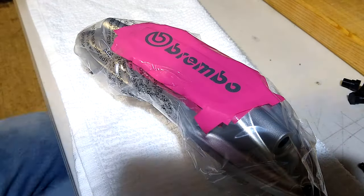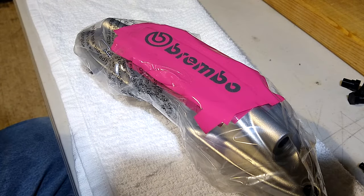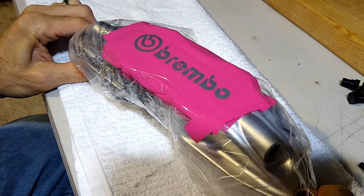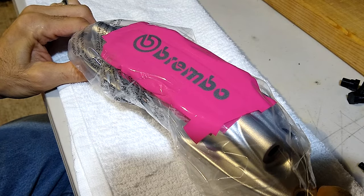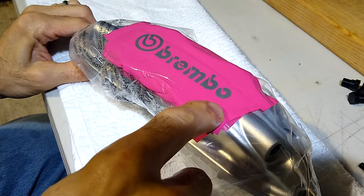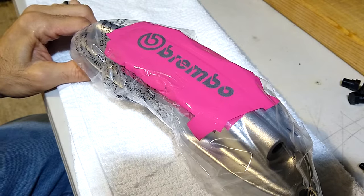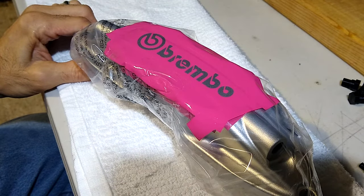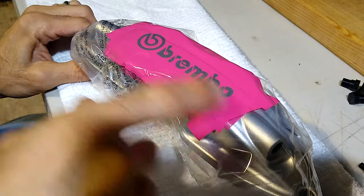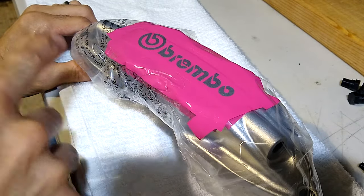Okay, here we are, round two of the logo. Getting ready to put it in the blast cabinet. This is the way you need to do it if you're going to etch from a polish, and then you want to etch to a coarser grit media. So you would have to have it inverted this way. When I first did it on the initial run, I covered the coarser finish and polished around it. That's why it looks different this time than the last time.